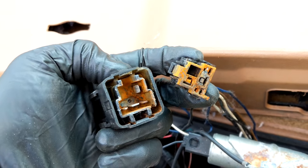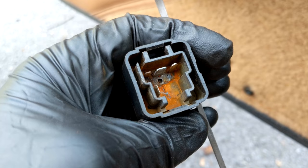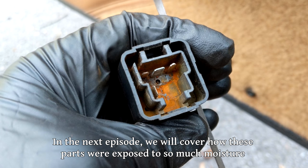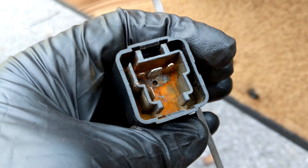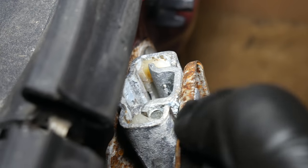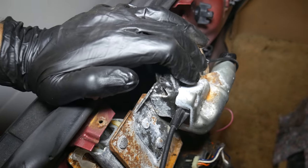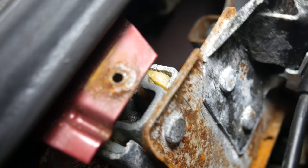After realizing this it was absolutely no surprise that the system was not working the way it was supposed to. The factory service manual refers to this as the extend relay - clearly this one should be replaced, although the functionality of the relay isn't entirely make or break, but we'll touch on that more later. In order for the relay to carry the current it's supposed to, these contacts have to be at the very least cleaned up. Other than the relay, the most obvious problem is how loose the latch assembly is, since the plastic guides it rides on have fallen apart.